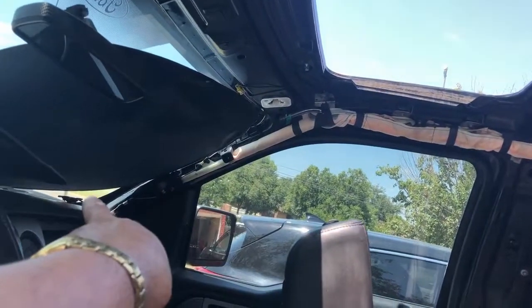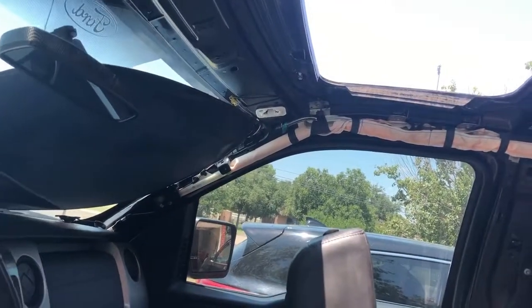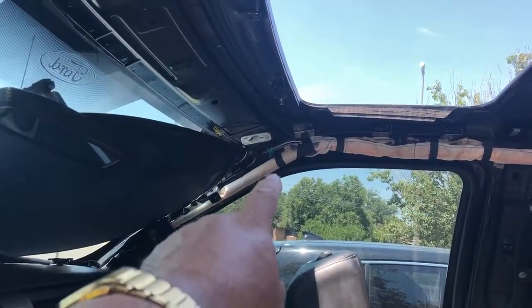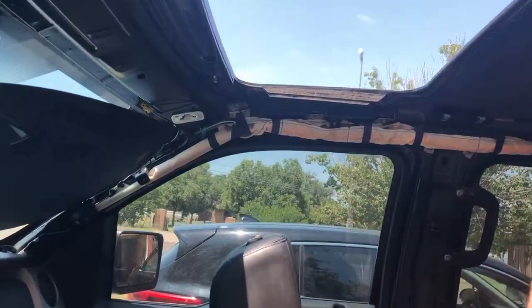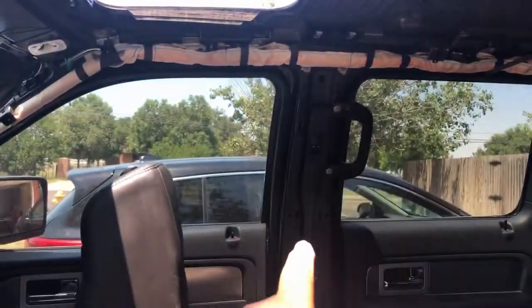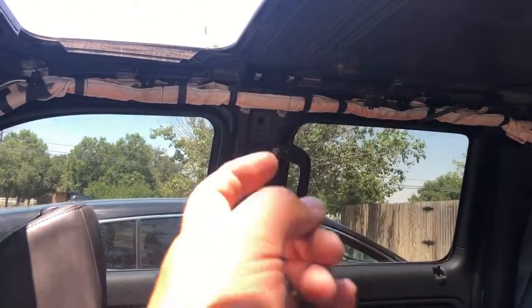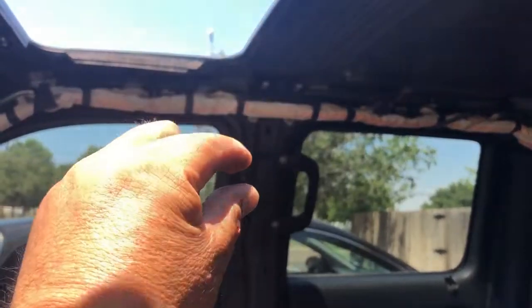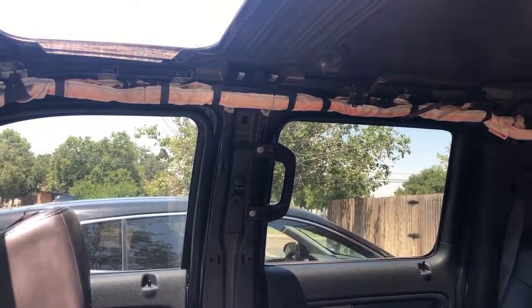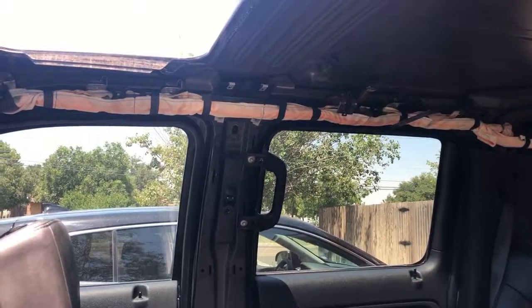I did the same thing there. Remove the screws for the speaker. You can see it there. And then I went ahead and pulled down the rubber pieces on the doorway, and I took the pillar covers off. On top, there's a little snap also that you pull off with a screwdriver or whatever. And on that one, I believe it's an 8. No, it also was a 5.5 millimeter.